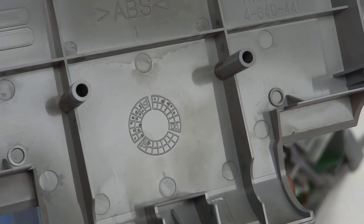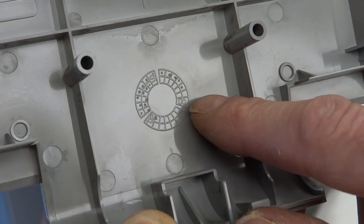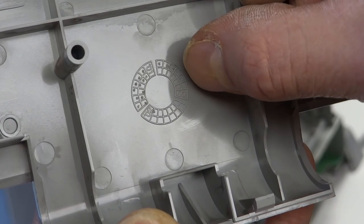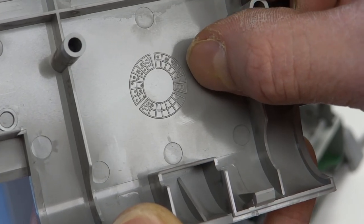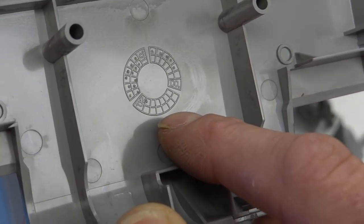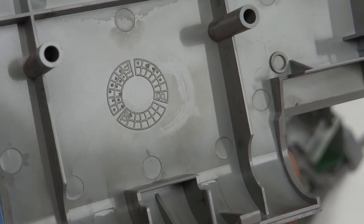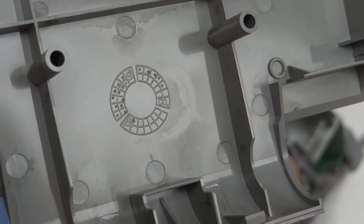Something I just noticed on the back cover of the monitor - there's a manufacturer's date code showing 2000, 2001, and 2002, with dots punched out for each month. There are twelve segments which must mean one for each month. So it's probably made between 2000 and 2001, though there's one little dot in the first segment of 2002, so theoretically it could be as late as January 2002 when it was manufactured.